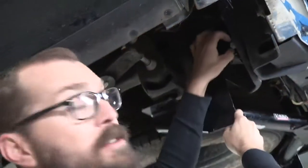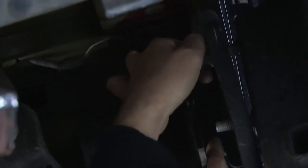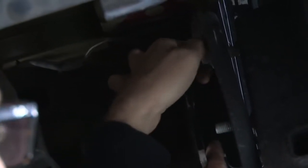With our hitch close to position, I'm going to go ahead and remove these two nuts from my bumper bracket bolts on the driver's side. And I'm going to slip the hitch in place over these bolts before moving on and doing the same thing on the passenger side.